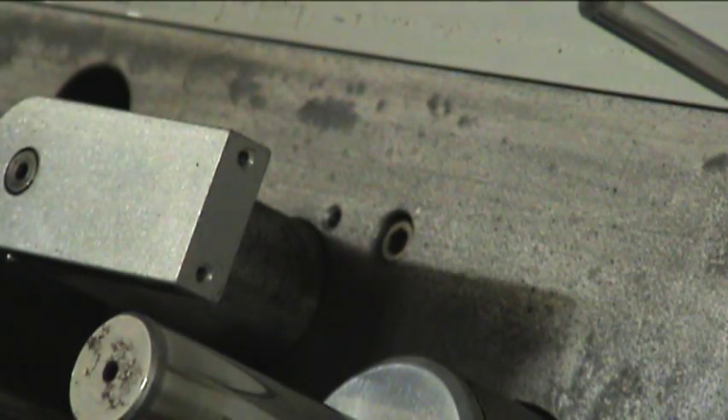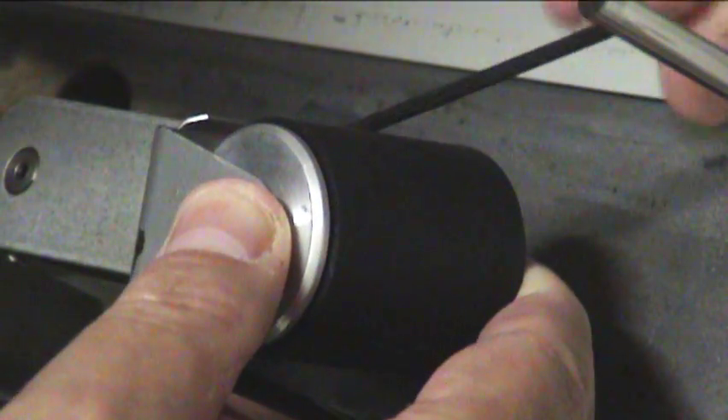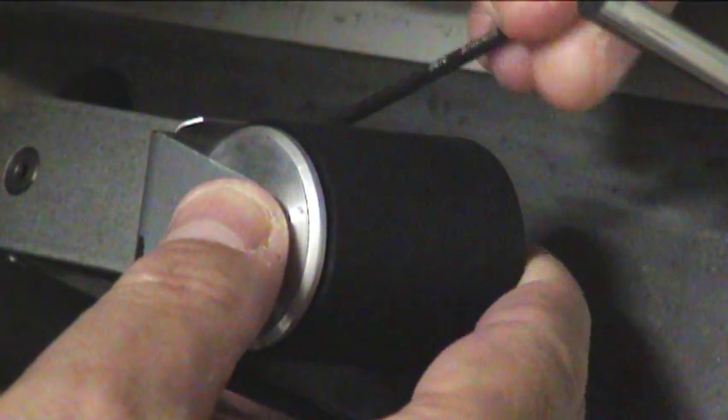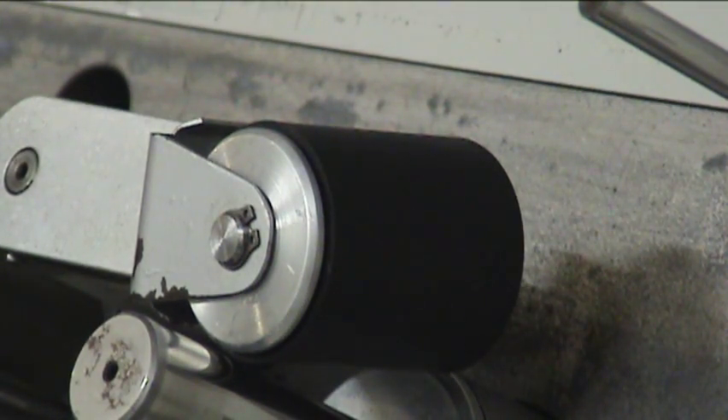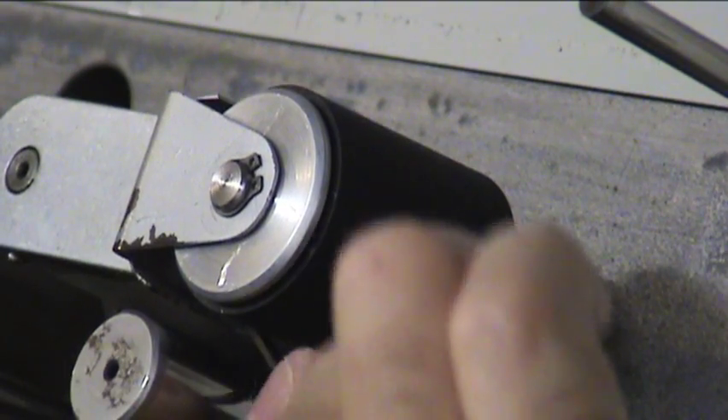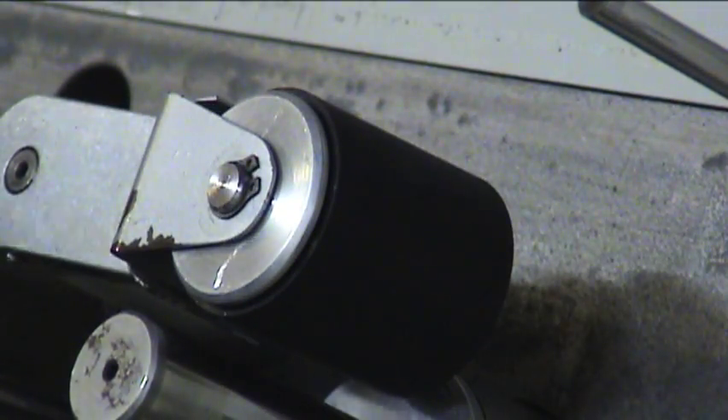That's the wavy washer on the back. This is where it is installed on the machine — that arm right there with the two holes for the screws. It's a little difficult to get to because the pinch roller is in the way, but you can maneuver the tool just a bit and get it to bite in. The top was connected and then we'll connect the bottom. After we get it nice and tight, looks pretty good. Of course we have to do the measurements for the actual force of the pinch roller, and that's a whole other thing.